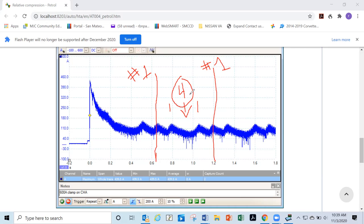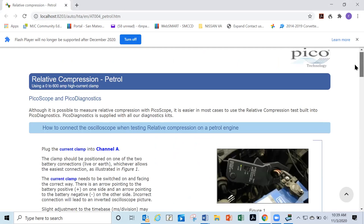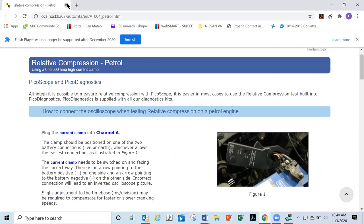We're gonna hook up to the negative side of the coil, or like I said, the side where the switching device grounds it, which again is considered the negative side of the coil, okay? All right, let me clear that. Okay, so besides that, let me get out of annotator here. And besides that, let's go back to other, let's go over here and then I'll show you some other waveforms, okay?